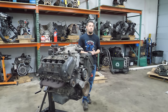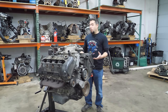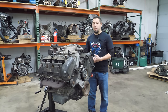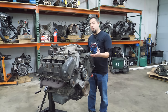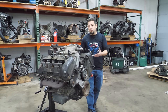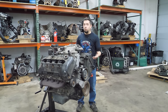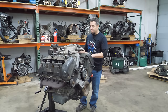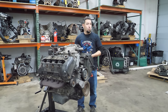The Marauder was essentially the hot rod version of the Crown Victoria. The Crown Vic has an iron block, single overhead cam, two valves per cylinder. The Marauder has an aluminum block, dual overhead cam, four valves per cylinder. These engines make just north of 300 horsepower - that doesn't sound like a lot by today's standards, but this was 20 years ago. These engines share similar architecture with other modular V8s from that era. It's essentially the same engine as an 03, 04, or 05 Lincoln Aviator - not the same as a Cobra.